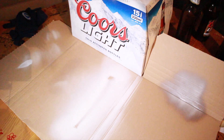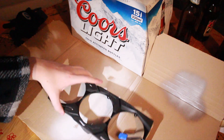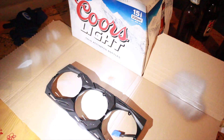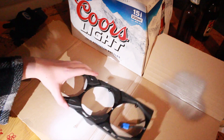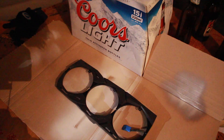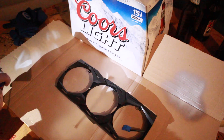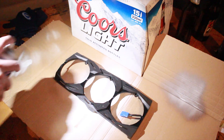This was a wide enough area to ensure only the card was sprayed. Don't just go right ahead, uncap it and spray on the shroud — that would be bad. Do one last check that the shroud is clean and free from dust, then shake the can like there's no tomorrow. Shake it for at least about 10 seconds. After that, give a few sprays directly onto the cardboard surface until it starts spraying that lovely white paint. Once you're sure it's shooting the white stuff and not firing blanks, you can start spraying.